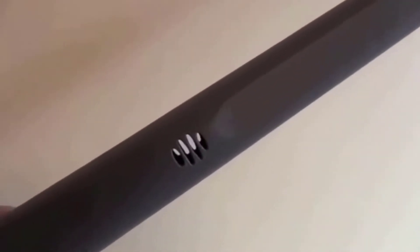I think the designers of the Shark Navigator Pro are well aware of the suction problem. If you notice here on this attachment tool, the wand device, about one-third of the way from where the handle would go, there's a set of ports in the side. The end is a very small tip, and if you were vacuuming a crevice like around a windowsill, you'd generate a lot of suction and it would cause the bottom gasket to break loose. To prevent that, they basically built an air leak into the middle of the wand on the sides, where it can suck air in from both sides to try to prevent that gasket at the bottom from leaking.